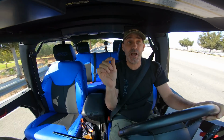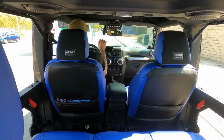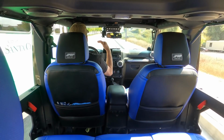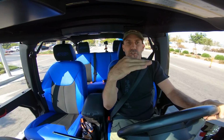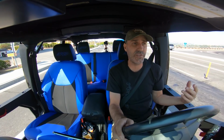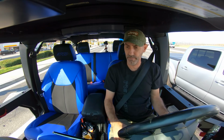I'm still nervous. Now, another thing about running without a stabilizer is that this is going to be super honest. There is nothing in between us and the steering. So to be able to feel this right away, I can tell you, going to high steer, there's much less bump steer in this, and that's when you hit a bump because of the geometry, you feel that through the wheel. It's actually noticeably better. So we've done a ton of just feel-good stuff to the Jeep. Wow.